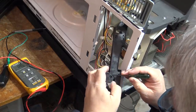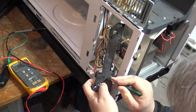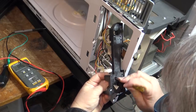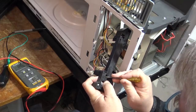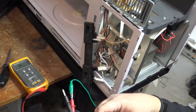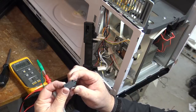Let's get the switch out of this unit. That's taken out by just pulling up - there's a little hook on the back here. You just lift that little clip up, and careful not to break the plastic because this piece is expensive. If you pop that little catch up and get a bigger screwdriver, the switch will pull straight back. That switch pops up like that - this is the bad switch. We can hook it up again and measure it - it's a normally closed contact - and when I push that down it should go open, but it's not, because the switch contacts have welded shut.